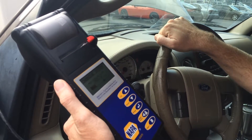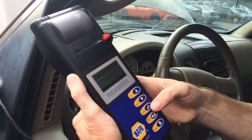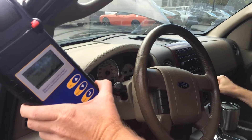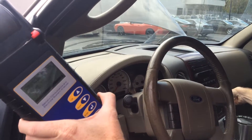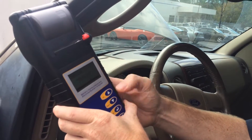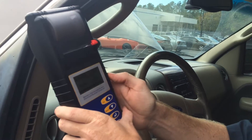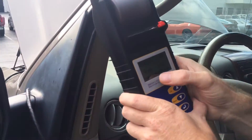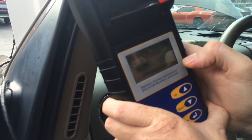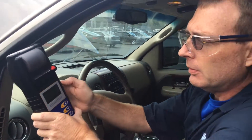Now it's asking me to rev the engine, then back down to engine idle. Turn the loads off and the engine off. The charging system had no problems. The no-load alternator was putting out 14.09 volts, and with it loaded it was putting out 13.91, which is within standards.